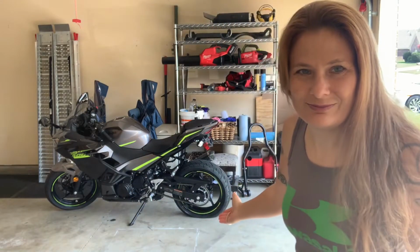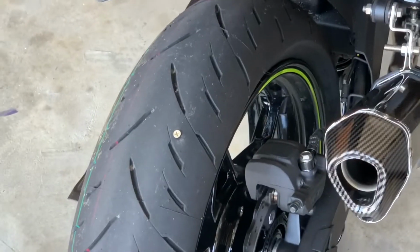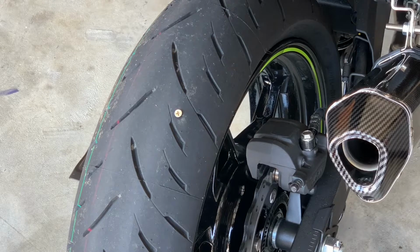I looked around, I couldn't see any obstructions. Turned off the bike, got off of it, and went around. I got a flat tire. There's a screw. Right there. But since it's close to the center of my tire, it's okay and I can plug it.